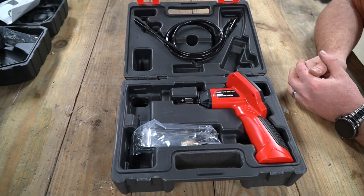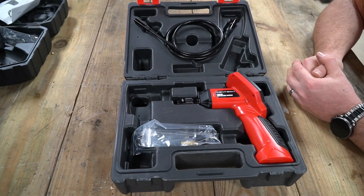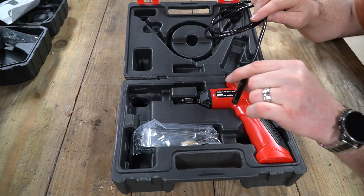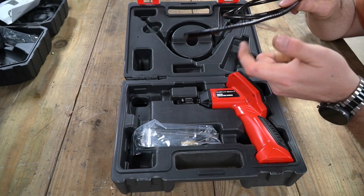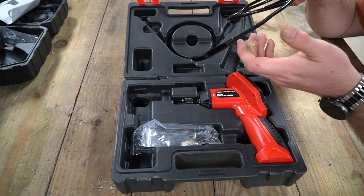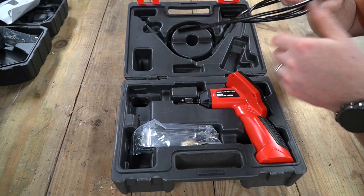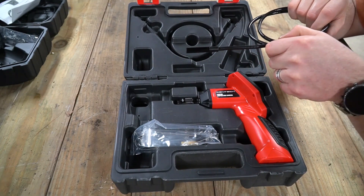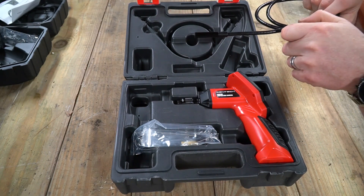What is an inspection camera? Well, it's just that — it's a camera that you use to inspect things. These all have one thing in common: they have a really small camera on a very long flexible stick. This has a metal bendy stick with a nice rubber coating over the top so that you can stick it down into places that you normally can't get a good visual on. It will fit down into a spark plug hole so you can look at the inside of your cylinder walls to see if they're scored, or take a look at the top of the piston to see what shape it's in. Pretty much, if you need to look inside something and it has a hole big enough for this tiny camera, you can get a good look.